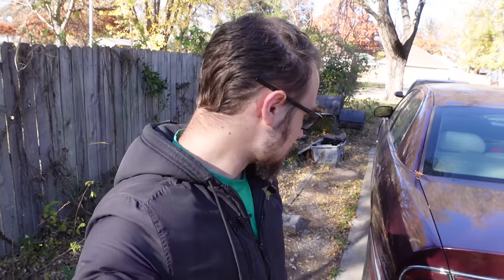Hello everyone, welcome to just outside the shop where I'm here with my Buick Park Avenue Ultra 2003, given to me by Tyler Hoover of Hoovie's Garage. I want to make it fast. I've had this car for about a year now and more or less it stayed sort of stock — we put some bigger injectors in it, upgraded it to E85 and retuned it, and we put a smaller pulley, I think a 3.6 or 3.4 down from the stock 3.8 inch pulley. We're probably at about 300 foot-pounds of torque right now, but I want more.